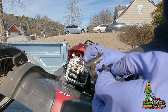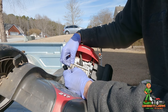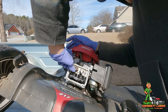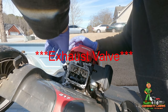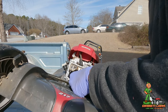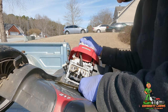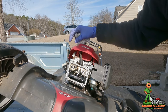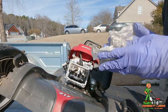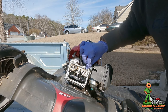I'm going to take the rocker arm and put it back in here like this — the pin just slides down in there. Now we have full intake valve travel. I was not getting full travel obviously, because the valve stem seal had moved up and was not allowing complete travel. While I'm in here I'll go ahead and check the clearances with my feeler gauge and adjust those. I showed how to do that in a previous video so I won't bore you with it again.